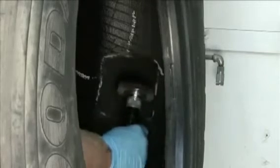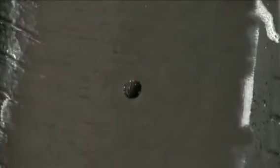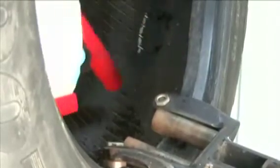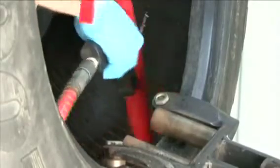Using a soft wire brush on a low RPM air tool, lightly buff from the right side of the prepared surface to the left side. You may need to repeat this process a second time to assure that all buffing dust and steel shavings are removed. Do not use compressed air to clean the buff surface. The air may contain moisture and oil that will contaminate the buff surface. Vacuum all buffing dust and steel shavings from the tire. When using a brush for cleaning, avoid touching the buff surface with the vacuum. This will lead to contamination of the buff surface.